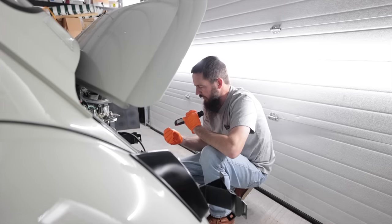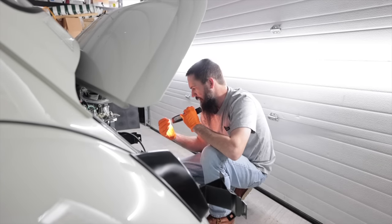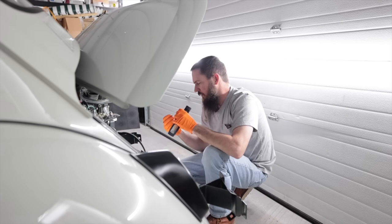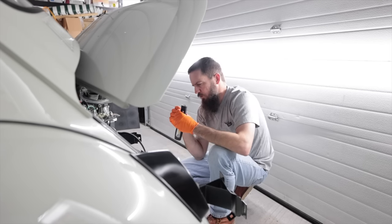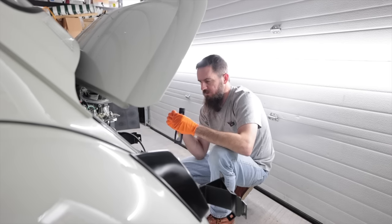It has too much fuel in it. It's a 140. It's supposed to be a 125. Oh, really? Yeah. Which jet? The primary. Which is weird because the secondary was supposed to be bigger, like a 165, and it's a 137.